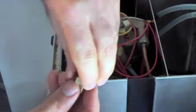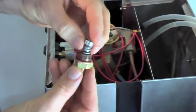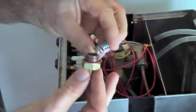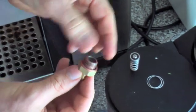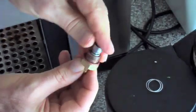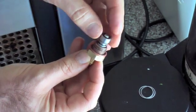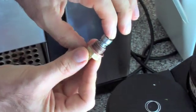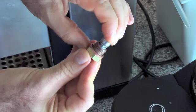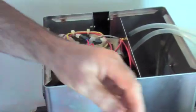Out it comes, and when it comes out there's a little piston, and that piston is held up in the pressure relief valve by this spring. There's a washer on there, so if I put more washers in there, that moves the spring back so it doesn't have as much pressure on it. This means the piston releases at a lower pressure, reducing the total pressure as you're making your espresso shot.